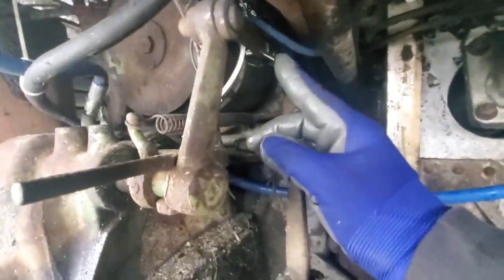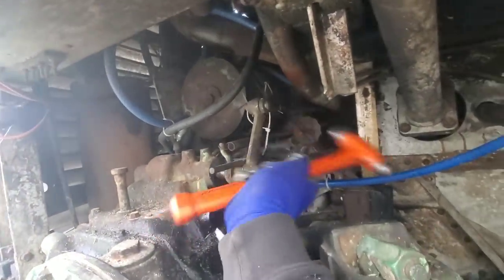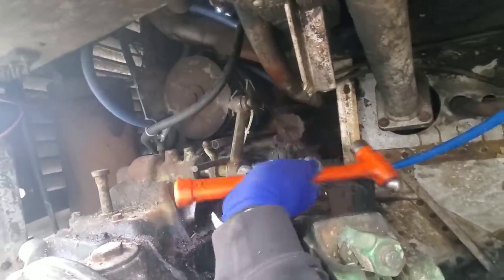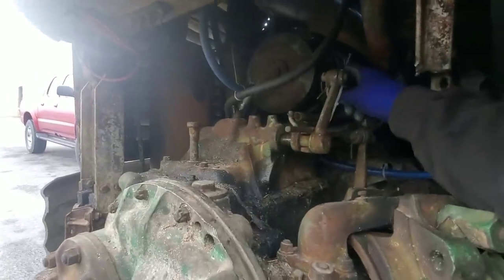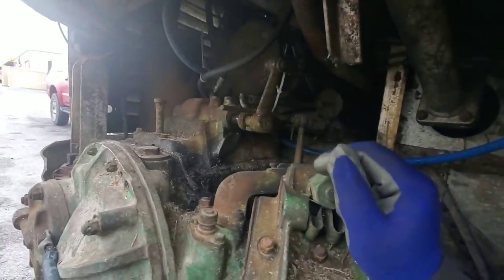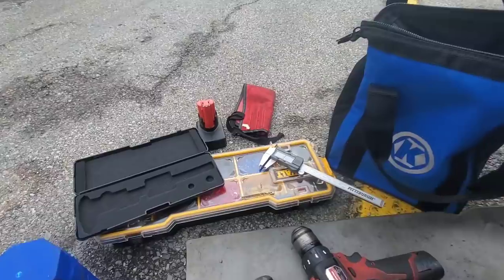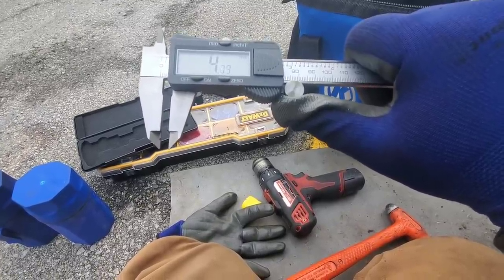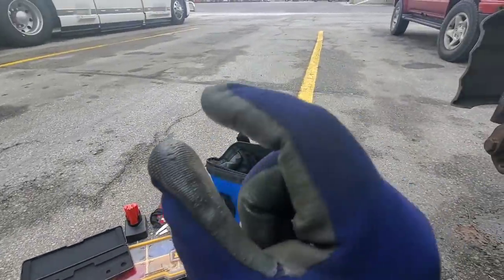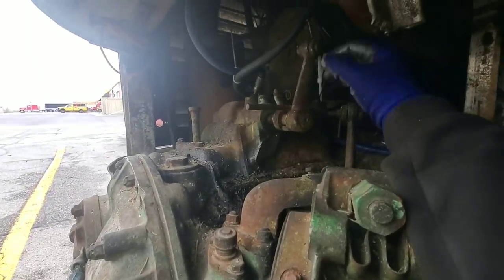Now I'm just going to drive that roll pin right the rest of the way through there. The hole does go all the way through so we can get the roll pin back out later. Seeing that somebody's already tried to put a weld on there, I'm not too worried about that in the long run. Oh — it's sticking through the other side too, so sweet. The roll pin is actually wider than that hole. The roll pins are a spring — this hole is smaller than the diameter of the roll pin, that's why you bring the calipers. The 3.93 millimeter is the bit I used, and the roll pin was about 4.20 millimeters or so. They have a slot cut through them, so when you put them in they squeeze in and are always pushing out a little bit so they don't want to come back out of their bore. That should fix that problem — we should be able to get it home on that.